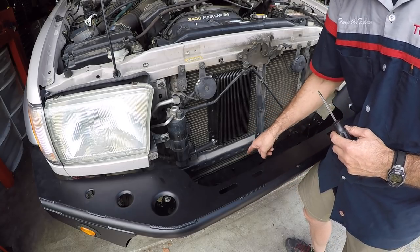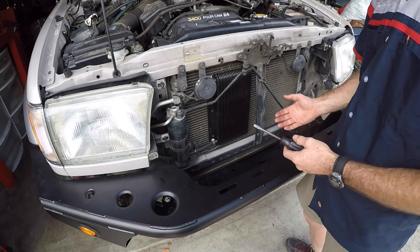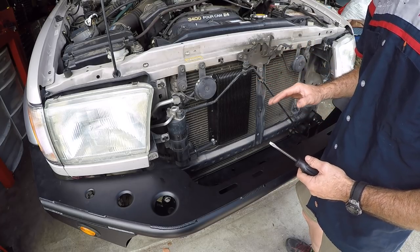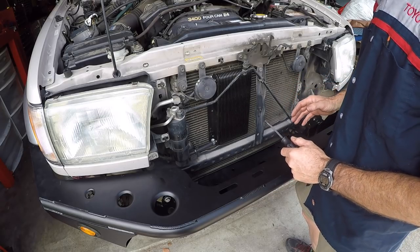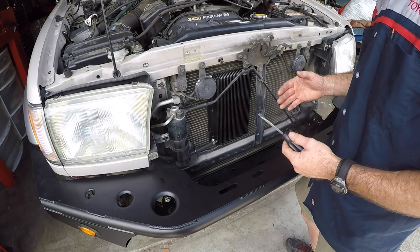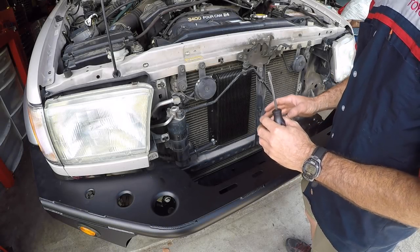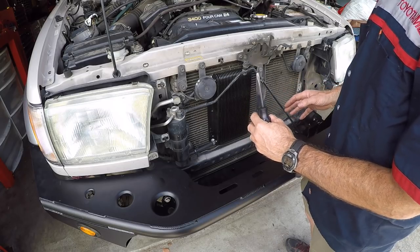The biggest access hole is on the back side and you can't reach your hand in there with a wrench. So we're going to have to pull this bumper off, set it on a table at a comfortable height, get the winch onto the bumper, and then put the bumper back on. We're not going to show bumper removal or reinstallation because we already cover that in another video — click the link above. The whole purpose of this video is to show you how to mount the Warn winch to the CBI front hybrid bumper and wire it up.